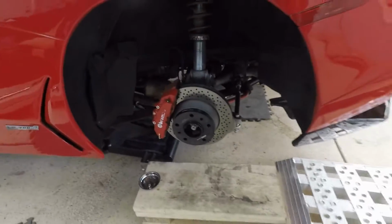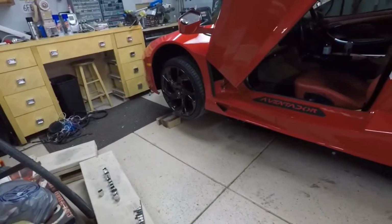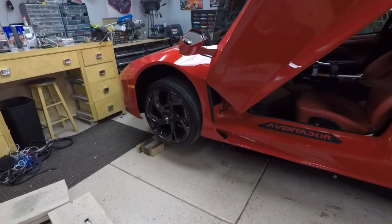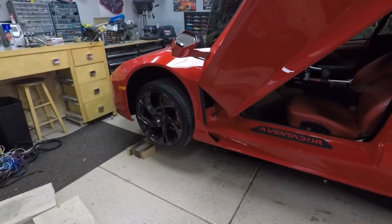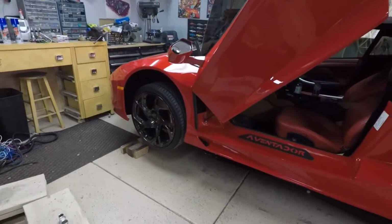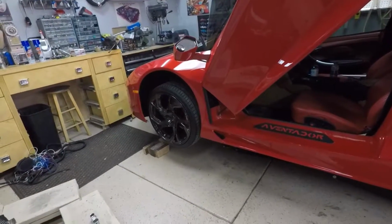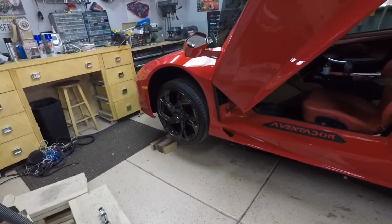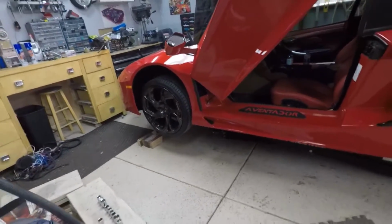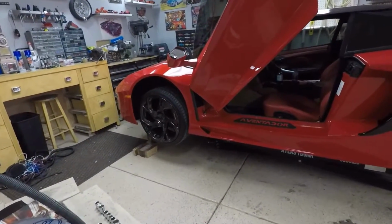Doesn't make it harder. I wanted to put them on the front, not that much, maybe 12 or so millimeters. But the problem is when I turn the wheel, the front of the tire hits the radiator. I already moved the radiator once. I moved it a lot, angled it and moved it forward because these are 19-inch wheels and the offset and all that. It really hit the radiator bad when I turned the wheel. So that's been resolved, but I can't go offset and bring it out even though I really want to.